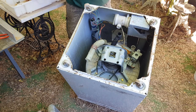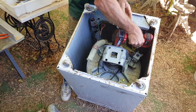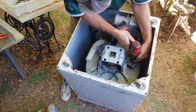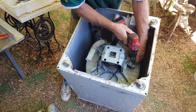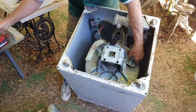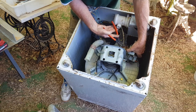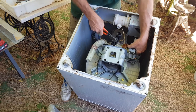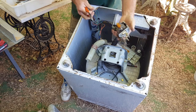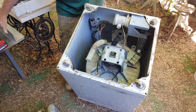The next thing to attack under here is the solenoid. It pulls the washing machine from the wash cycle to the spin cycle — generally just a screw each side. Most of these upright or top-loading washing machines are all constructed similarly, so the parts are easy to identify. The solenoid comes out with the two screws; cut the wires again. The little connecting link is often plastic — rather than mucking around getting cotter pins out and undoing clips, I just cut the plastic link with the cutters. Solenoid out, and it has good copper windings in it.